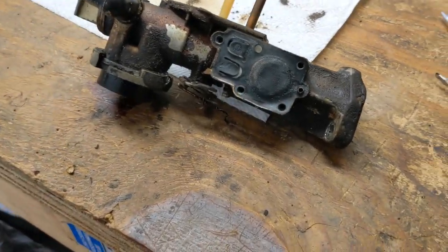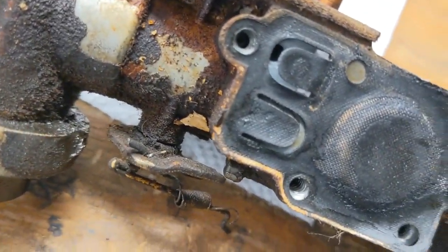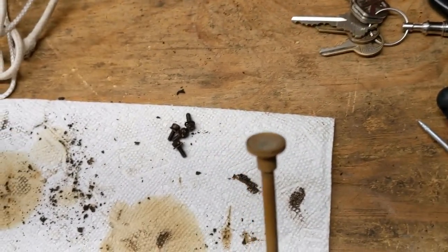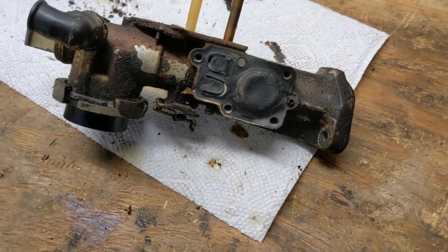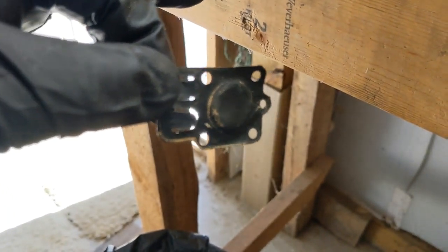So this is what we discovered: it was difficult to get the carburetor cover off without damaging anything, and you can see the rubberized coating is starting to come off the diaphragm. I don't know if that's going to pump fuel or not - I don't have any replacement here. The little filter screens were pretty clogged up - they've been cleaned off and blasted with carb cleaner. I still have to go through the needle and check it, but I suspect it'll need the diaphragm. I couldn't leave well enough alone when I took the gasket off - you can see daylight through it where the rubberized coating has come off the center. It's not torn but that's no good.